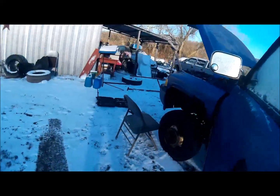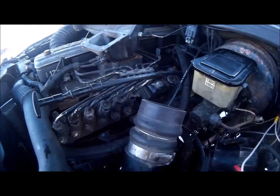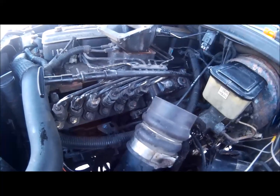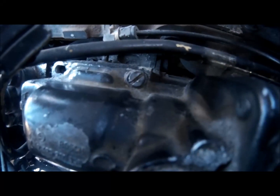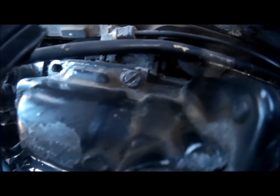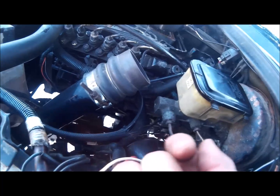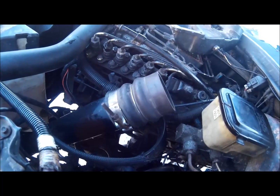Hey folks, Steven here. We're doing a smoke screw adjustment on the 12-valve today. I've already had the AFC off — there is a tamper-proof screw on the back of it that's going to prevent you from doing the job. Your best bet is to remove the AFC; it's going to be four bolts. One is going to be a flathead screw and the other one is going to be a tamper-proof. There are multiple ways to get that tamper-proof out — I decided not to show it in this video because there are about a million other videos on YouTube and forums covering every different way depending on your skill set and the tools you have.